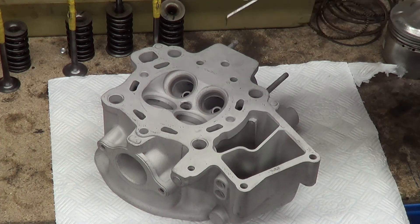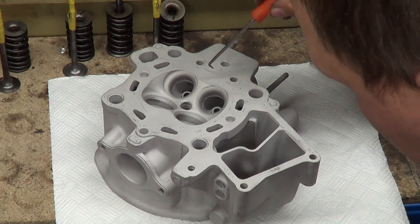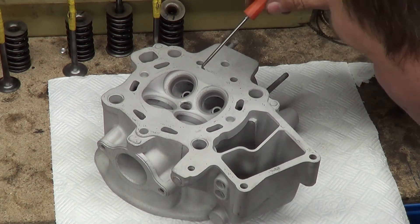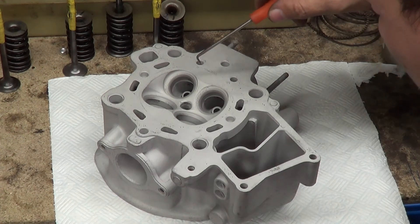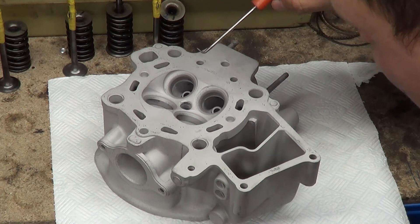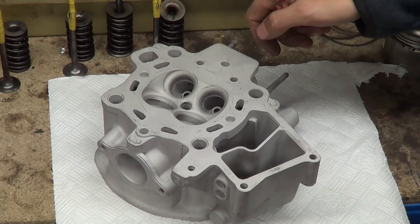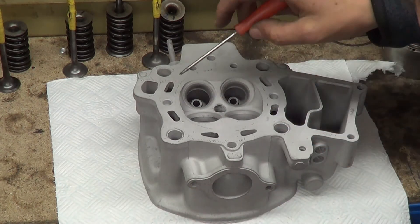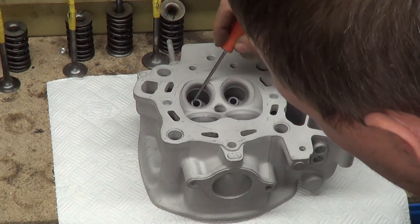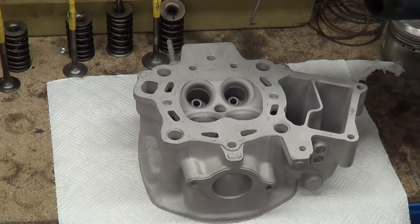So this is a preliminary blast. The weird thing I've noticed is that either these valve seats have been re-cut - which I doubt - or these are from the factory, and they are shocking. The reason why they are shocking is because they are not perpendicular to the valve guide. Or they may be, but then that means the seats aren't, and I'll show you what I mean.